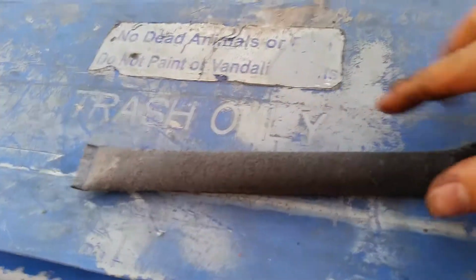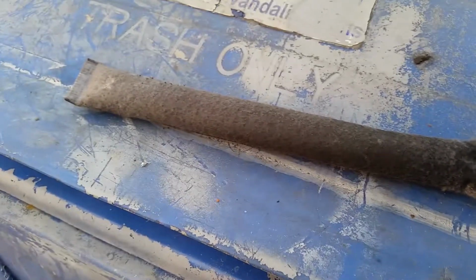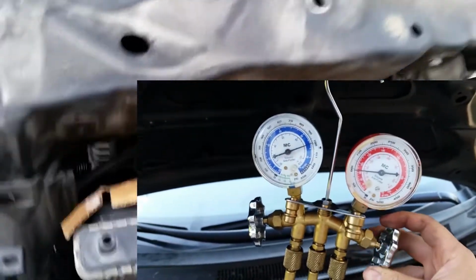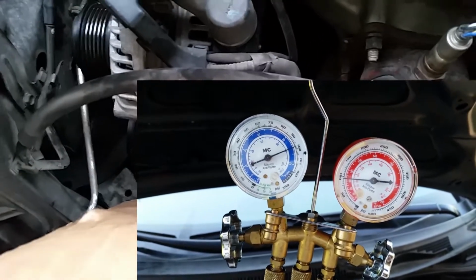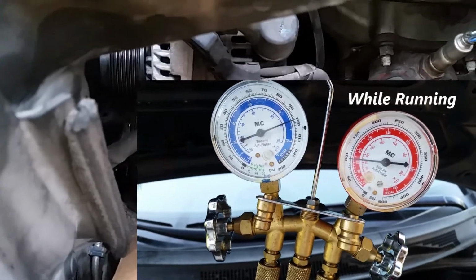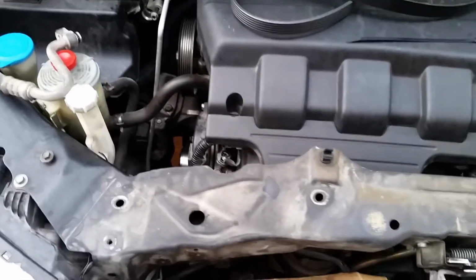And it was saturated with moisture and dirt and filth, and the condenser didn't seem to be flowing too well. And upon further diagnosis of this, I found that the pressures on both sides of my gauges were reading about a static equal pressure. So it was spinning, the clutch was engaging, but I was not building any high and low side pressure on